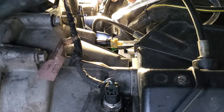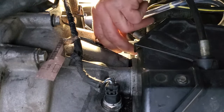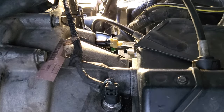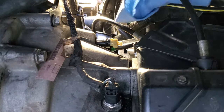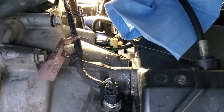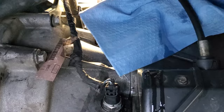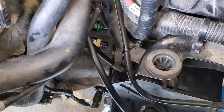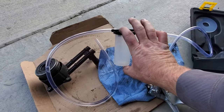Okay, so once you get almost all 4 ounces, or 3.38, go ahead and close your valve. Let's go ahead and remove the line here without making a mess. All right, guys, so I went ahead and sprayed some brake cleaner and then also put my dust cap back on there really quick. And come around here, you can see pretty much used almost all that 4 ounces there.